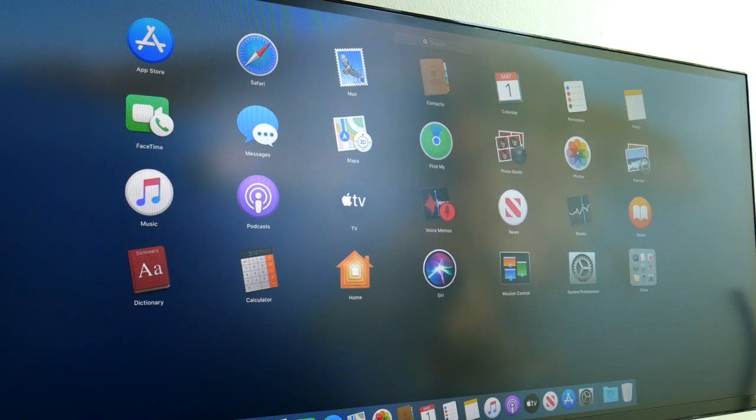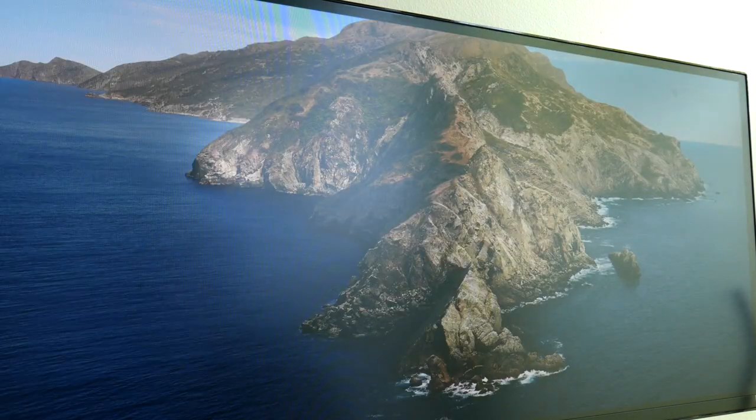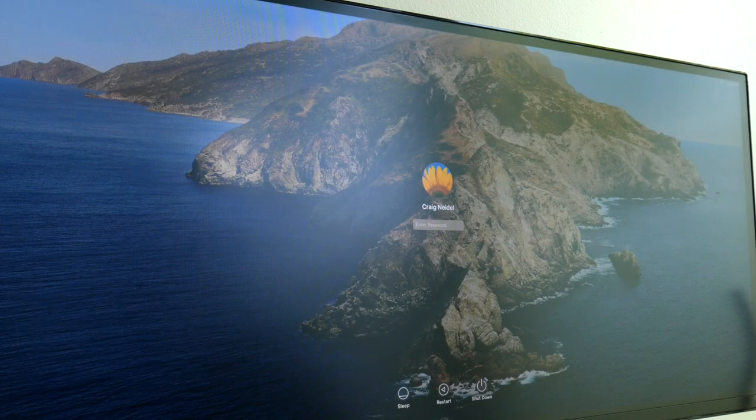All your applications in the dock are gone because you're starting from scratch. You can boot back into your old internal hard drive — I'll show you that in a moment. Let's go ahead and restart right now. It's programmed to boot back into that external SSD drive, so make sure it's always plugged into your Mac Mini. If you had a spinning drive it probably took a couple of minutes to boot up. On this SSD — and this isn't even the fastest — the Apple logo comes up almost immediately. It takes about 20–30 seconds and everything's back up.